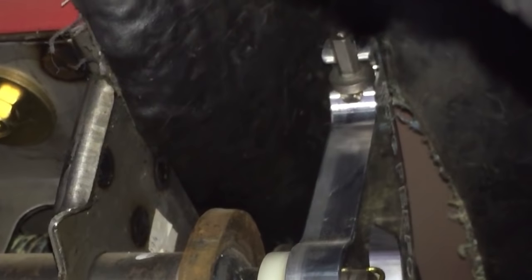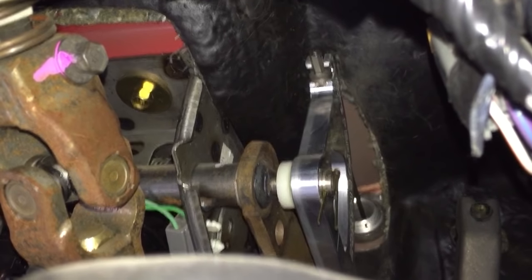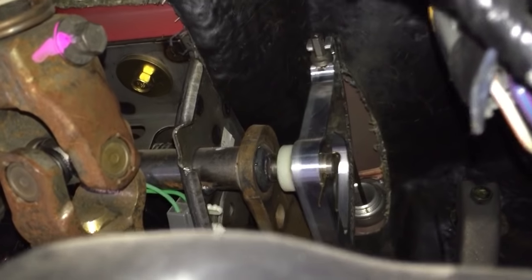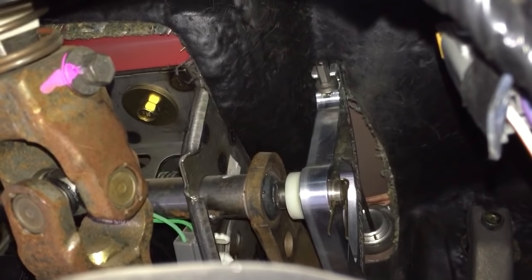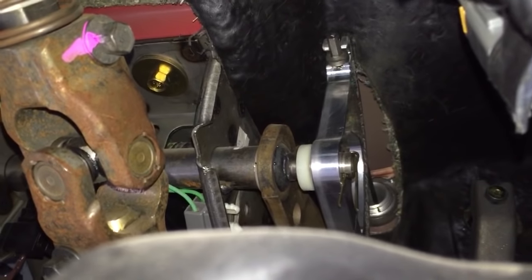Just to go under here and show you what the clutch quadrant looks like if you have an aftermarket one — it's this silver piece right up in here. A lot of these come with two hook locations for the clutch cable. This one's a Fiori brand and it actually only has the one spot. The Steeda one and some others have double hooks so you can choose which one to put it on, which helps with adjusting using the firewall adjuster.